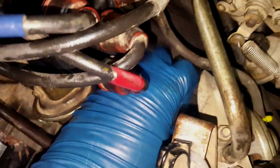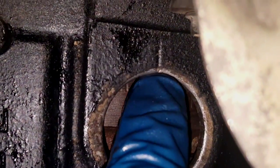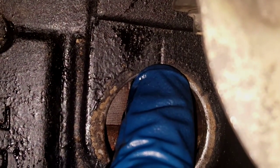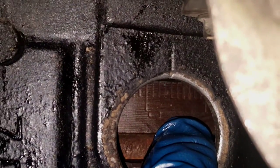After you get that, go to your transmission case. There's a little plug underneath the EGR, and there you'll have your timing marks. Here's the mark on the transmission case — you want to align that up. Mine is about seven degrees top dead center, so it's perfectly on there.